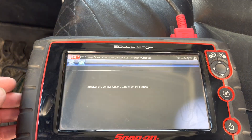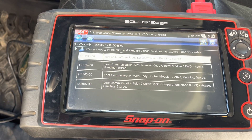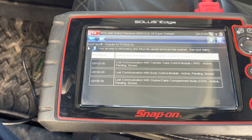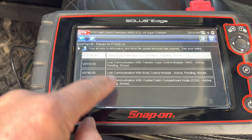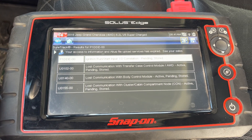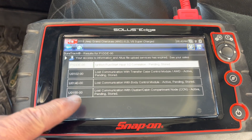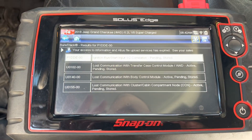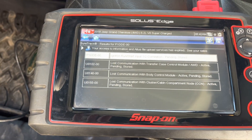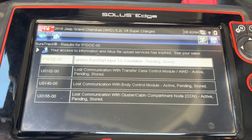Check codes. Those codes are always going to be there — these are from the car that's missing, so it's missing the Grand Cherokee. It's going to have these codes; those are normal. Because we didn't do anything special with this transmission, it's mostly stock. These codes will always be there, so don't panic about them. Remember, this is only going to the transmission — it is not necessarily information from the Jeep. This is information from the transmission.